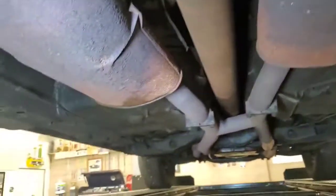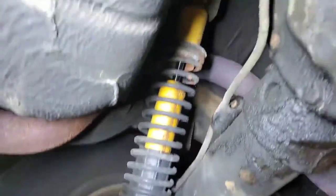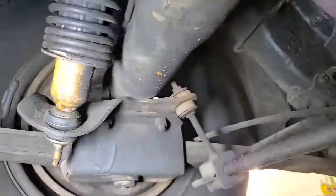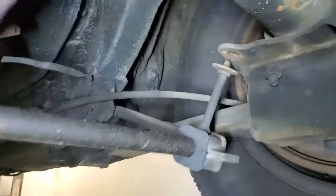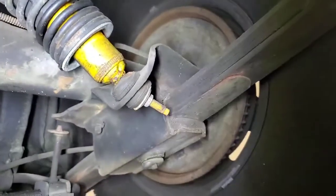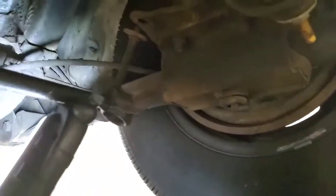At some point I think this car had an event. As you can see, the springs are kind of de-arched, so they're going to get a replacement - I've got to get a set of those on order. And the original owners tried to compensate with some load-leveling shocks. These sway bar mounts are originals - this one doesn't look too bad, but I think this car suffered an event, because if you look at that one, it's broke right off. The bolt on the shock is bent right over at the bottom there, so it's got kind of an odd angle to it. Something kind of hit this and probably broke the bar - these are the lowest points, so it probably impacted the bar and broke it.